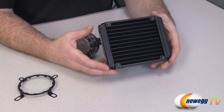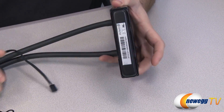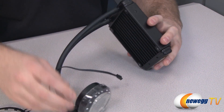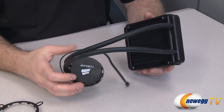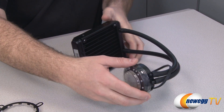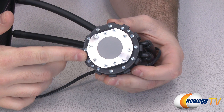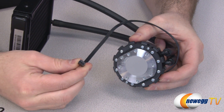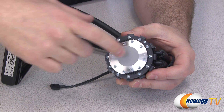Here's a closer look at the H40 radiator and cooling loop. The radiator is 150mm wide, 120mm tall, and 25mm thick — make sure you have enough room in your case to mount it without obstructing other hardware. This is the entry-level SKU in the Hydro Series line, so there are a few differences: the tubing is rubber as opposed to the FEP tubing used in the rest of the line. The CPU cold plate is aluminum rather than the copper used in higher-end versions, though still effective. There's also a 3-pin connector to power the pump. The cold plate has thermal paste pre-applied — that's the gray area in the middle.